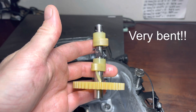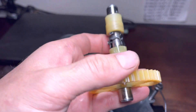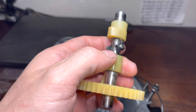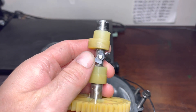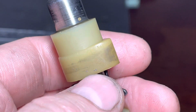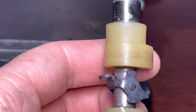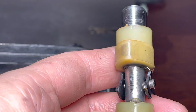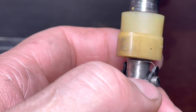Now a closeup of the camshaft that's been cleaned. I don't know how this little decomp — this automatic compression release — works. At the moment it's not working, obviously. I don't know if it's missing a part. I haven't taken one of these machines apart before, so it's the first time I've seen this. I feel like it's missing something. There is a bit of metal transfer there, and that is probably what's caused the swirling pattern on one of the tappets I'll show you in a minute. It's obviously broken — there's a spring on there that's not working how it should be.